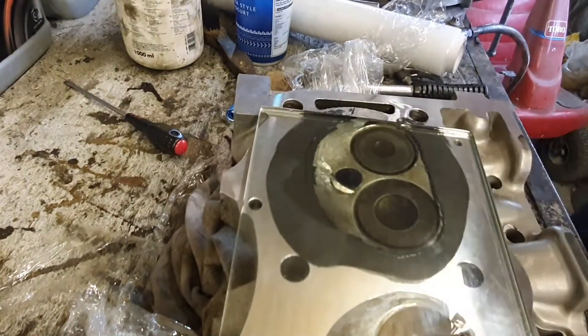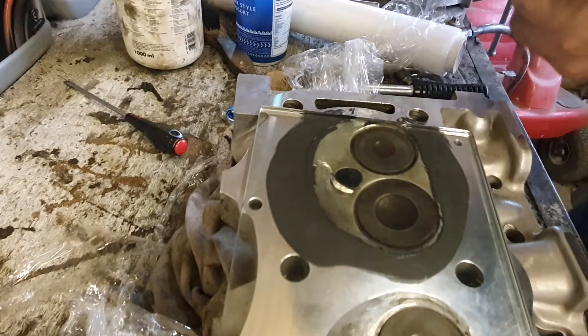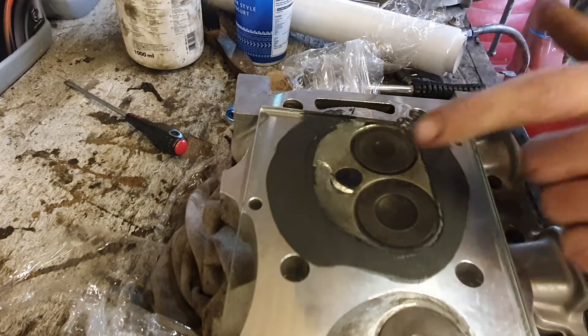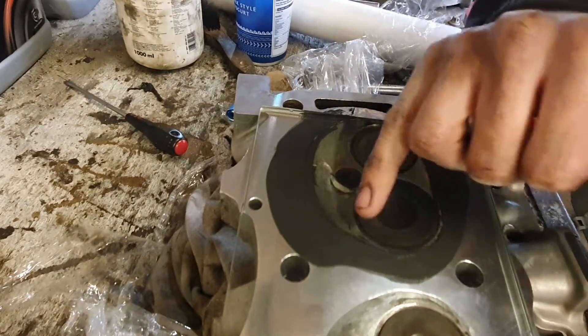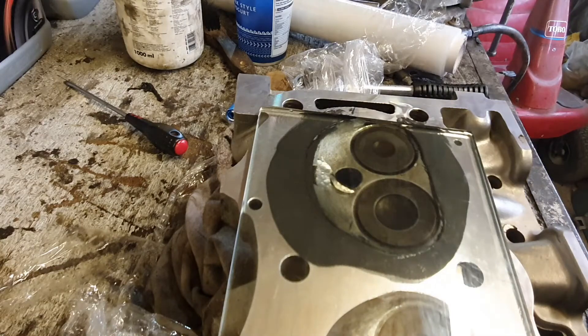So it's 24 cc's. It is actually coming out now but that was 24 cc's, so I think it might be alright. You can see the petrol dissolving the sealant already. I'll come back to you with the compression ratio.